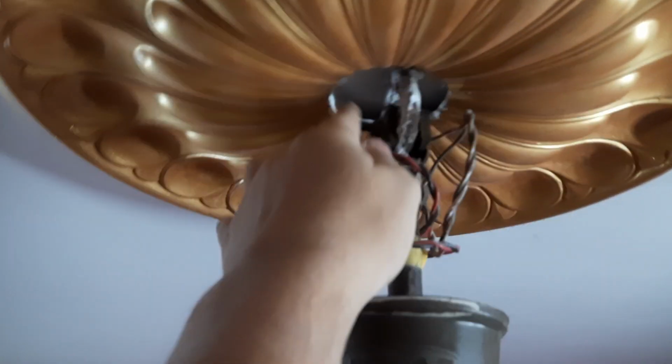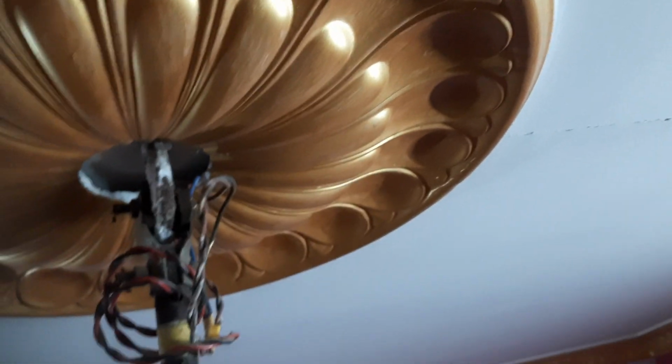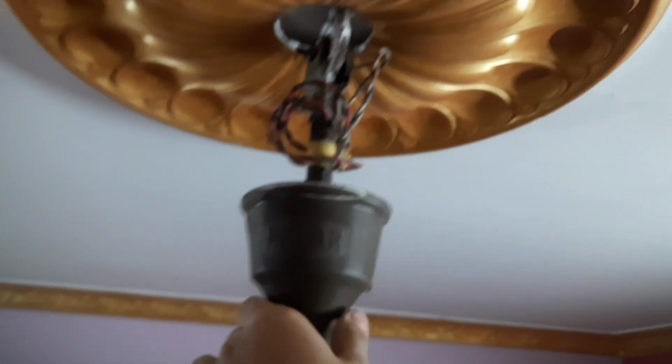As I can see, this is the shackle, and let me show, these are the joints of the fan. This is the wiring wire. These are two wires, red and blue. The red wire is connected with the red wire of the wiring, and the black wire is connected with the blue wire, which comes from the winding. So let me show the cap.